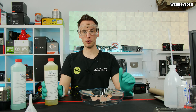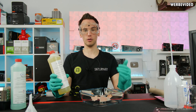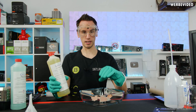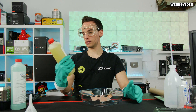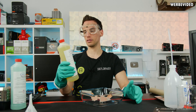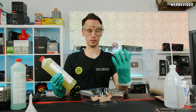The next step is coating the heatsink with palladium. We only need a very thin palladium layer, but without it the nickel layer won't adhere to the copper surface. This step is required for brass, copper, and similar alloys, and will take about 20 minutes. Note that this can be very dangerous — another reminder to wear goggles and gloves throughout.